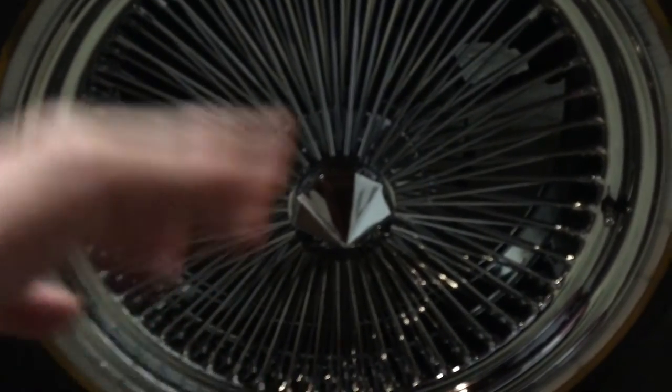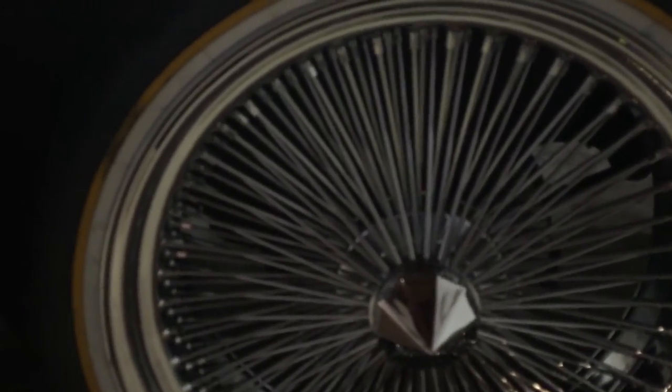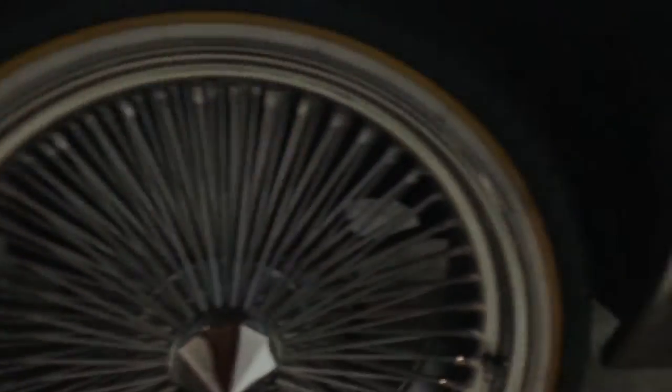Like I said, 150-spoke wire knockoffs. Just got to make sure after you put these on that you retighten them after about 20 miles. Make sure you use the hex and hit it with a hammer — don't be afraid to hit it as hard as you can. Drive for a while, take some turns, get all the rubs out.